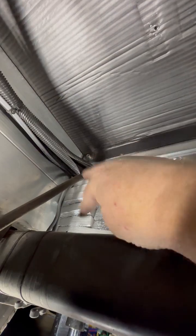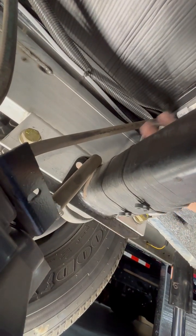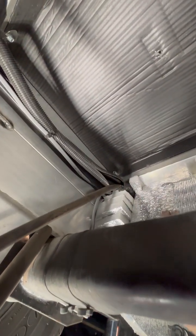It looks kind of cheesy, but all of the lines actually have the double-sided tape and insulation stuck into every single little hole. And then because all of this is different elevations and heights and everything else, each piece kind of represents something different and is protecting something different. Like this is actually tucked in next to that. This is that condensation line or evaporation line from the tank. And this looks kind of cheesy, but that corrugated and that other piece of insulation will come around and cover all this up, and this will help protect this from that tire slinging all the snow and ice and everything else up next to it. So to kind of keep this pretty protected.